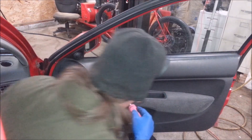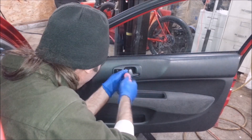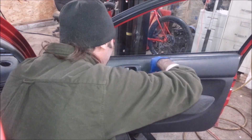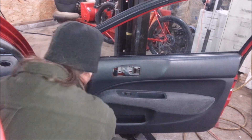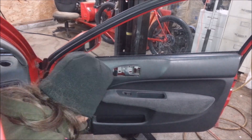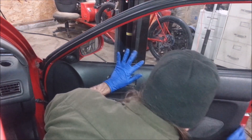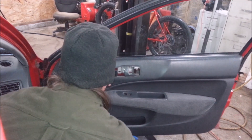I'm going to get this door panel off of here. There's a Phillips screw here, and a Phillips screw here. Take that panel off — there's a Phillips screw here. There's supposed to be three, but there's only one. I'll probably be finding some to put on there. Then you can get a door panel removal tool and pop this out, or just pry in there.